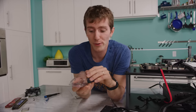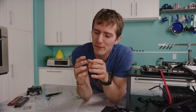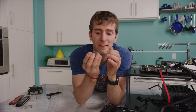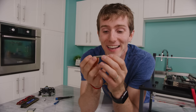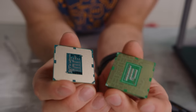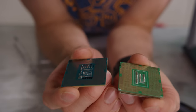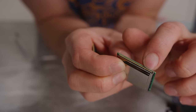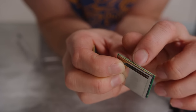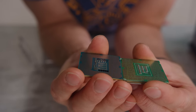So step number one is inspect the goods, because when you order from weird random Chinese sites — this took just over a week to arrive, which is not bad. The first thing that stands out is that this heat spreader is clearly custom milled by whoever is finding these CPUs. I'm going to flip them over and this is where stuff gets really crazy. This is a 4790K and this is a 4720HQ — desktop chip, mobile chip. You can see the comparison between the thickness of them. You can actually see the ball grid array soldering job between the original CPU and this aftermarket substrate. And not all the contact pads seem to be actually mapped to anything — some of them look blank, like they don't have a trace running to them.